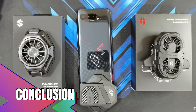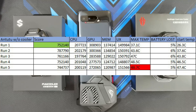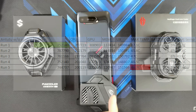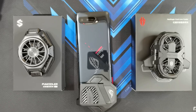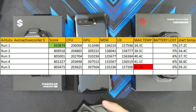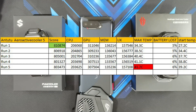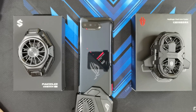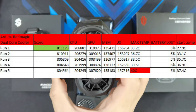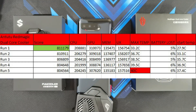So to wrap up guys, I'm going to be showing you the results that I noted down for each of the four tests. Without any cooler attached, temperatures maxed out at 48.7 degrees — and that update actually made a big difference because some of my earlier tests with AnTuTu made the temperatures go higher than 50. With the use of the AeroActive Cooler 5, the temperature only maxed out at 41.7 — that's a full 7 degrees lower. And for the Red Magic Dual Core Cooler, the maximum temperature was only 40 degrees Celsius, which is an additional 1.7 degrees lower than using the AeroActive Cooler 5.